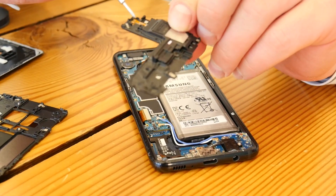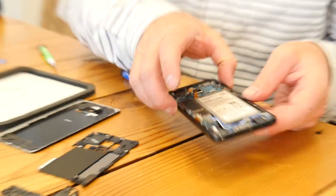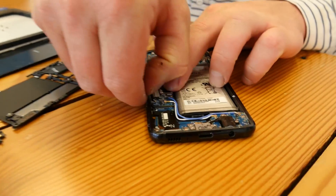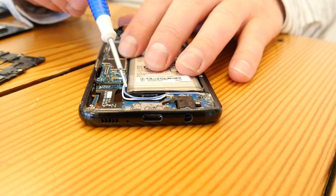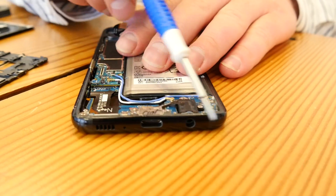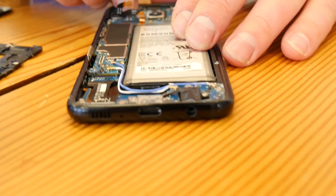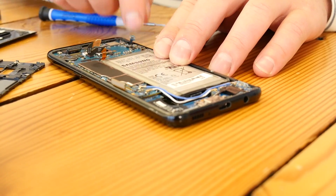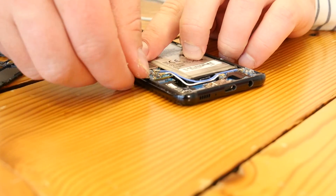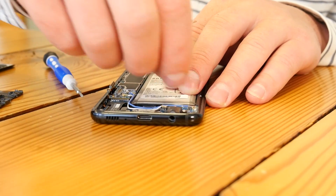You can see the connection to the logic board is through these two touch points right here. We're going to keep doing the teardown and remove the logic board. We have a couple of connections to pop off. This connection is the digitizer — basically a fancy word for the touchscreen — as well as the LCD. We have two antennas: one is the WiFi and one is the cellular, connecting down here. The antenna is actually bridged on this bottom aluminum point as well as the sides. We also have the top camera connection and the side buttons connection, as well as this bottom antenna.